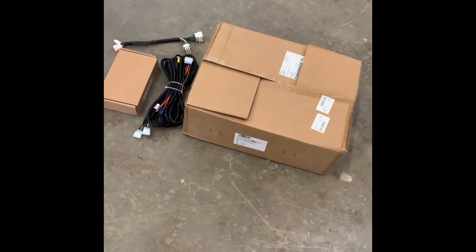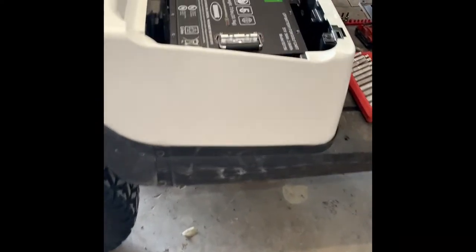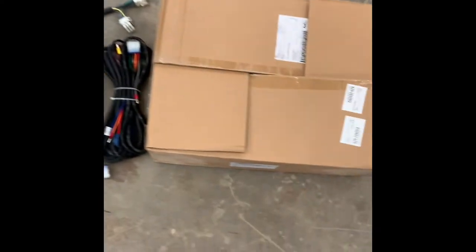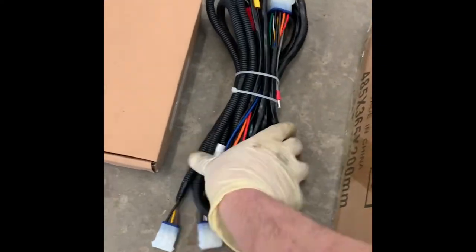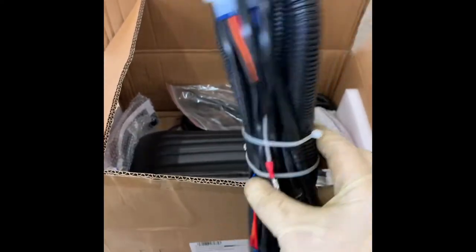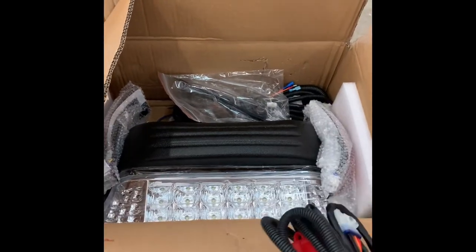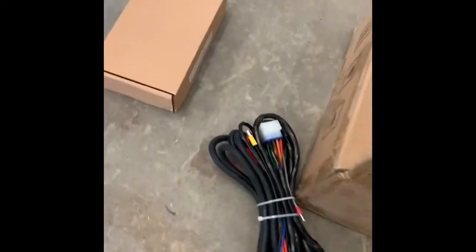We're about to do an LED basic light kit on a 2012 Club Car Precedent. We did the lithium battery conversion on this one, so we will have to run a voltage reducer, which is purchased separately. You can order your LED basic light kit which fits the 04 through 08.5 without the bucket harness. If you have the 08.5 and up, it has six 8-volt batteries and does not come pre-wired, so you have to purchase the bucket harness separately. Since we're running 48 volts to a light kit that needs 12 volts, we're going to have to run a voltage reducer.